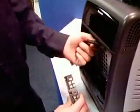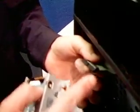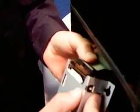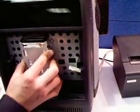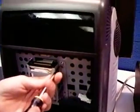Okay, on this ribbon cable are a set of little holes. You're going to want to match up the last two holes on the right with the teeth on the right of the hard drive. If I line up my holes correctly, it should slide right on. Okay, right on. And these two pins are left empty. Alright, once we do that, you're going to want to get this flush against the metal, pull it down, and now we can tighten the top two screws.